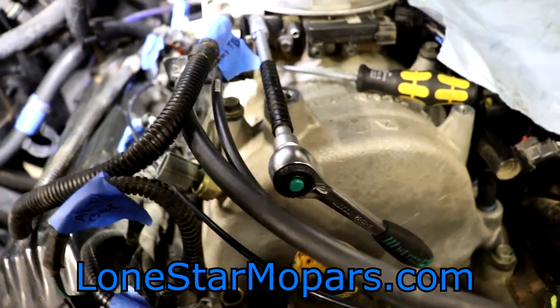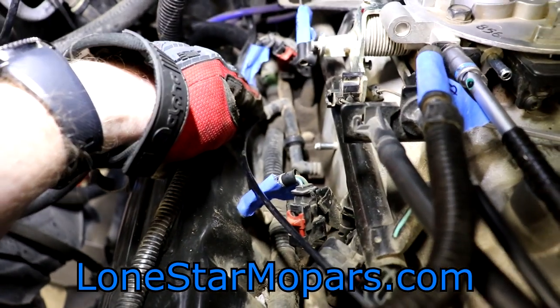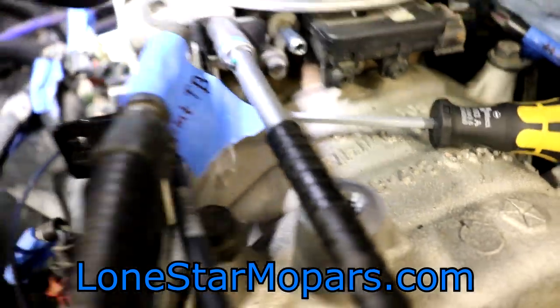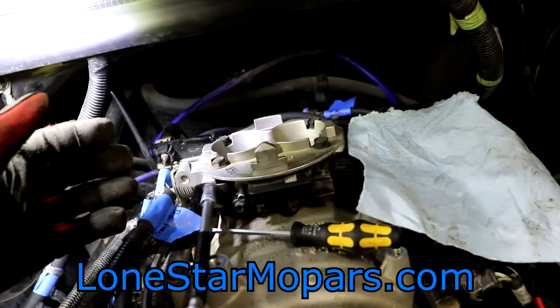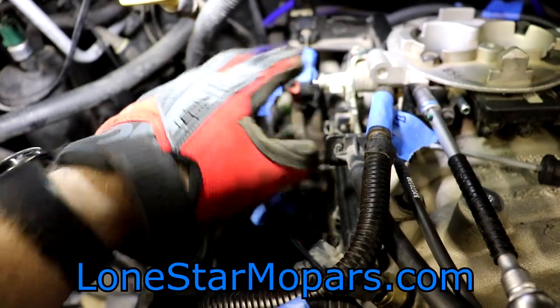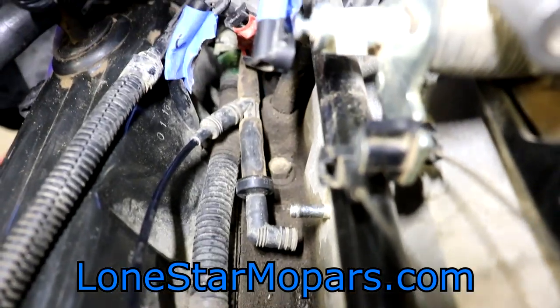Using a little slotted screwdriver I'm able to pry any of these vacuum connections off. I'm trying to get better access to that one without breaking the plastic tree — I'll never know how hard it's going to be to find Y fittings. I've got my 5/16 socket here doing its job. Bolt one, bolt two, and then around here bolt three — that is going to allow me to get the throttle body off, which I think will open up space. Then maybe we'll tackle the fuel rail. Mainly though, this bracket portion I wanted to get out of the way so I could move things back, because it's just turning into a jumble of wires back there.